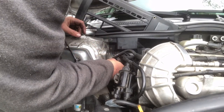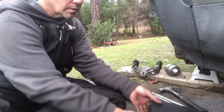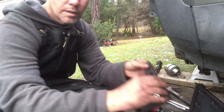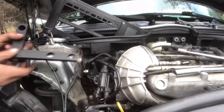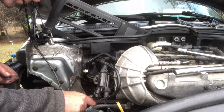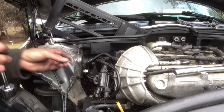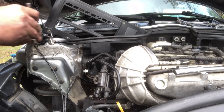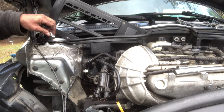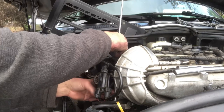To keep track of the bolt, put it right back where you got it. Now get your cam sprocket tool — I'll link where I got it in the description. Jack the motor up a little to get everything to line up, then slide the support bracket in where the motor mount normally bolts. Take the two 19 millimeter bolts that come with the kit and use a magnet to install them so you don't drop them.